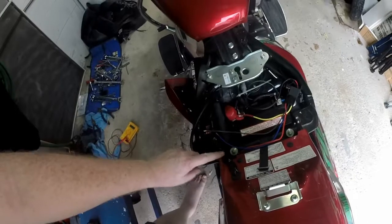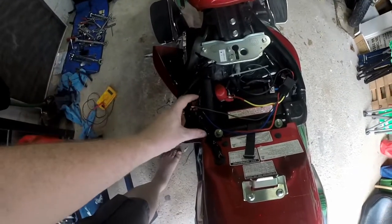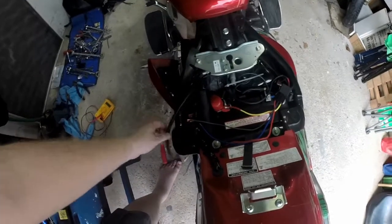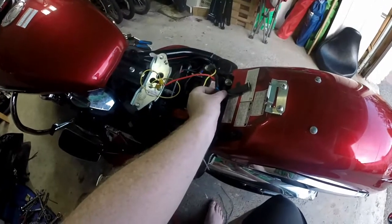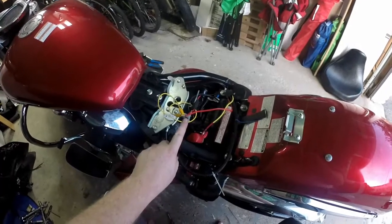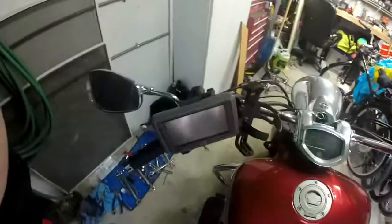If you remember, the blue wire was spliced up here and the black down here, so that they don't ever have a chance of having those two terminals touch each other. So I'm gonna do the same thing — got the black wire splice marked with a white zip tie and the blue wire splice marked with a blue zip tie. I've got my accessory power hooked up to the only thing I need right now, which is the nav system.